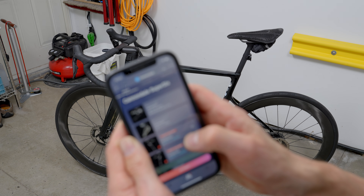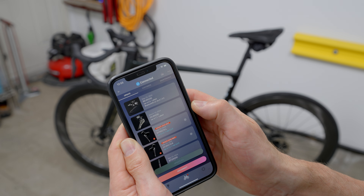Running outdated firmware can also create new problems, like what I experienced myself. I was struggling to figure out why my Di2 wasn't shifting properly, thinking it might be a hardware issue. But what I should have done first is connected my Di2 to the Shimano eTube app. Had I done so I would have immediately noticed that Shimano launched a new firmware update, and after bringing my Di2 firmware up to date the shifting problem I was experiencing disappeared. So lesson learned — don't neglect firmware updates.